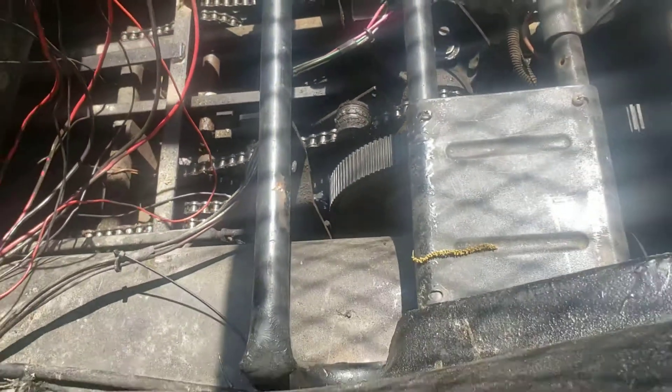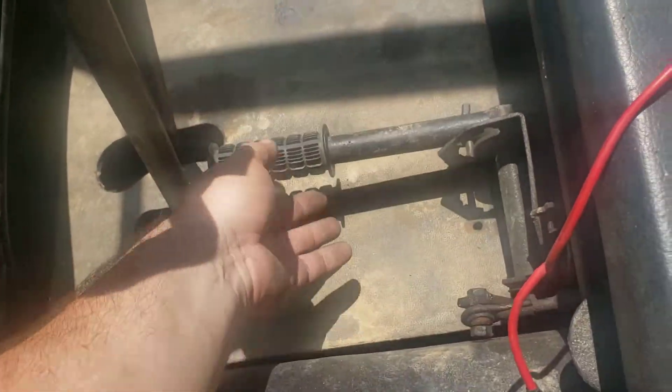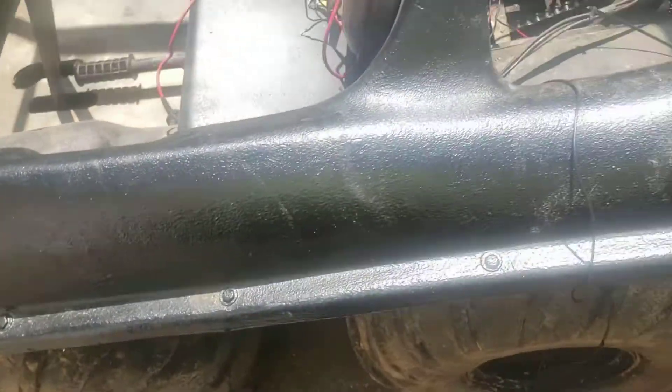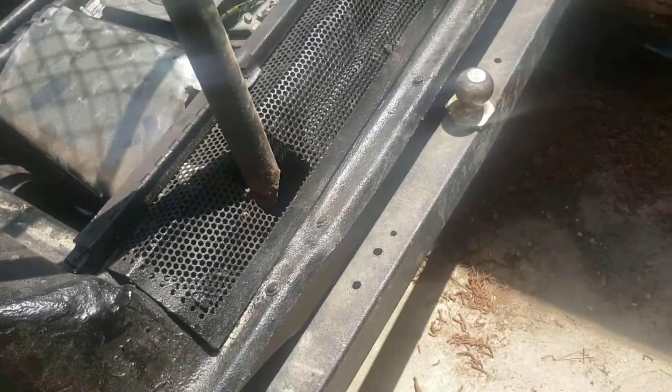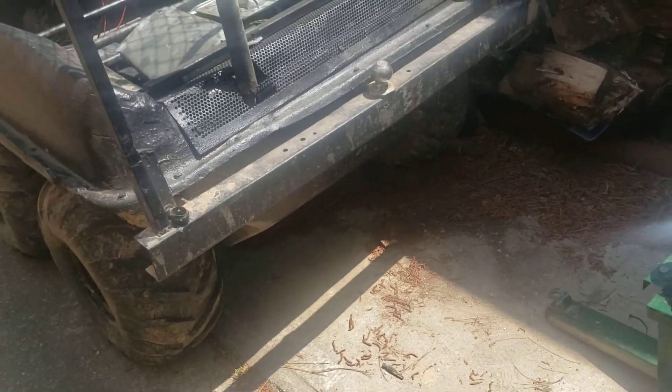If you know anything about Argos, there are supposed to be some levers on these little arms connected to these little knobs — those are the shift forks — and they are not connected to anything. It is stuck in forward right now, and the little shift lever doesn't do anything. I've got to see if I can fabricate something to make those work like they're supposed to. The chain is also off on the front sprocket up there. And this exhaust is broken off too — it's just sitting here with nothing connected to it.